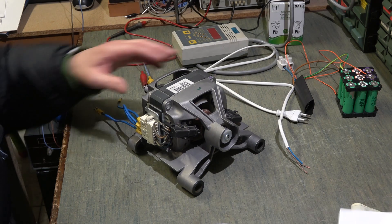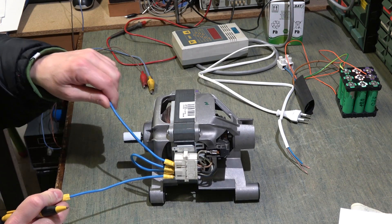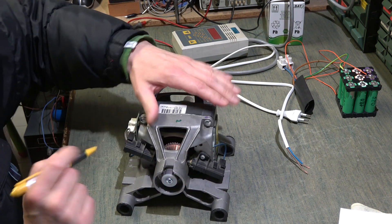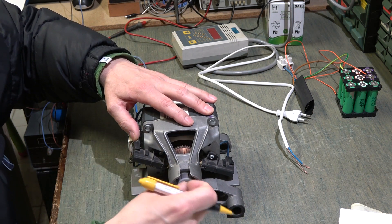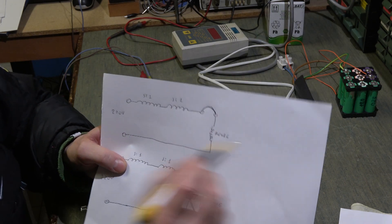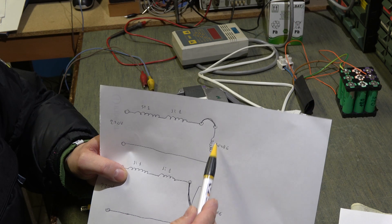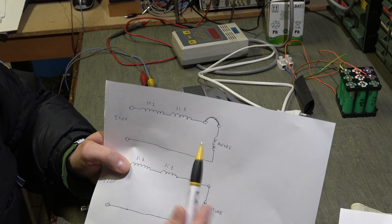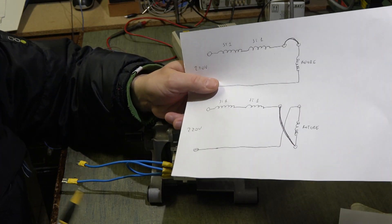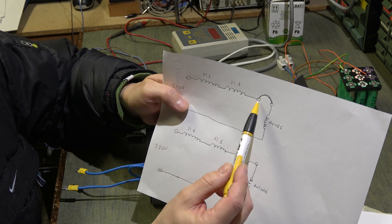The manufacturers have simplified things — they have brought out only four wires. There is space for the other two but the internal junction is no longer accessible. What they did is make a series connection of the two stator windings and the rotor, with the other polarity on the outside. Now I will show you the example of how it is connected.